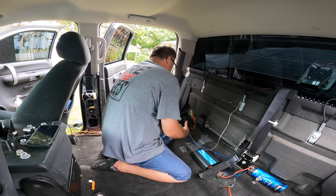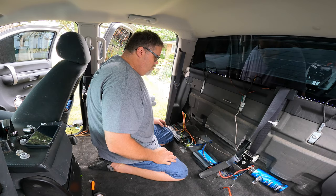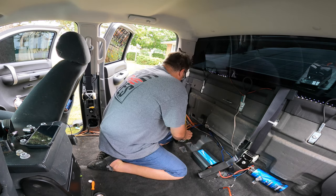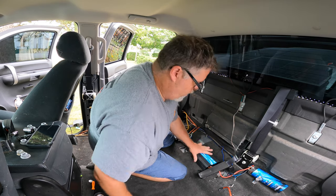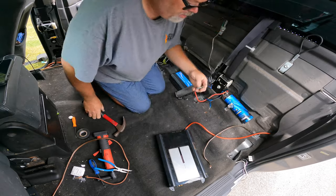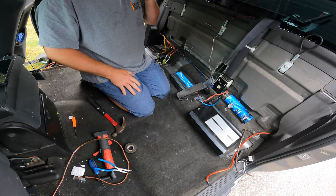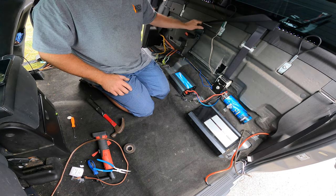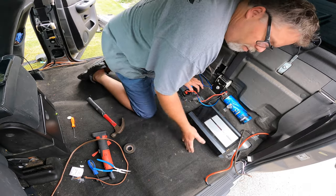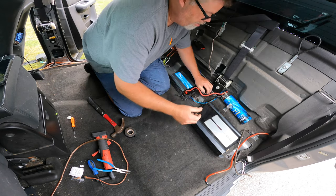Should try to spin this amp around if we can — this way gives me some extra wire. These wires all have to go up in here so they miss the seat. This has got to go up here so it misses the seat. Get these over here somehow. That was for the jack if anybody's wondering, that's why we don't need that. So now this amp should be able to go here — sure can. The problem is I had all these amps wedged up in here and they weren't fitting very well. With them here it should be okay. The sub box sits about here. Power and ground back on it — we better tape up this power wire because I can see what's going to happen. Always tape up your power wires until you're ready for them. We need the RCAs — that one might just reach. We might have to extend one, which isn't bad if you only have to extend one.